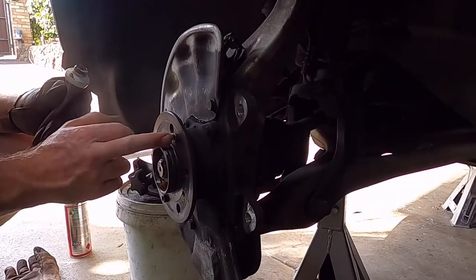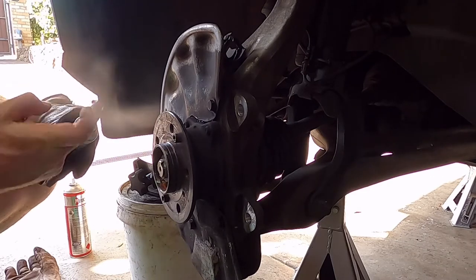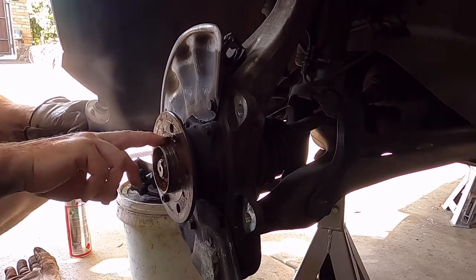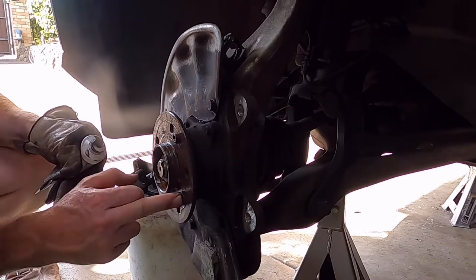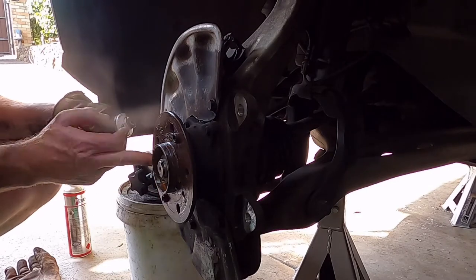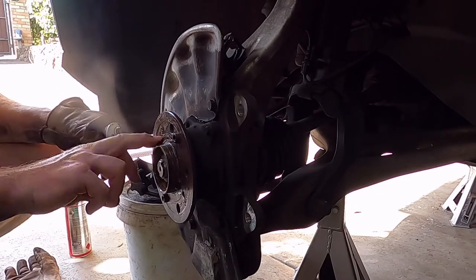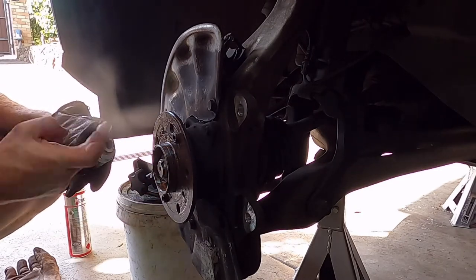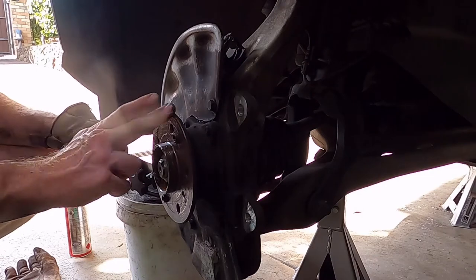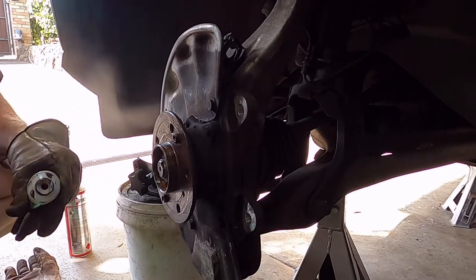Just pushing those pistons back in and just nipping up the top there and checking on the master cylinder level as we go. So as before, get the copper slip on the hub here. The disc can just sit there, and even though I do a lot of pressure washing of these rims, trying to keep the brake dust off them, if the water gets behind, even between the alloy and that steel there, soon start a bit of rust going on. Even this copper slip will dry out over time. Need a bit of a cleanup, especially when I take the wheels off. We got a bit too carried away there, but let's see how we go.